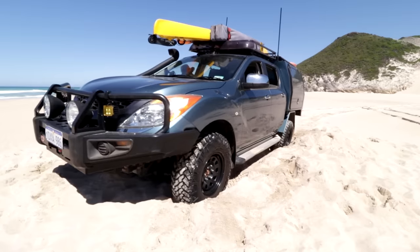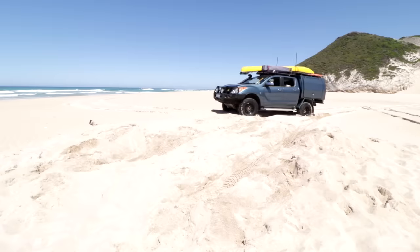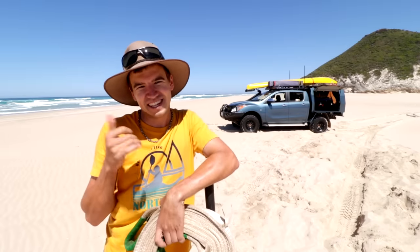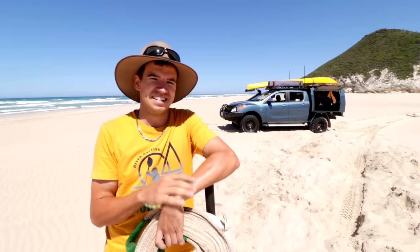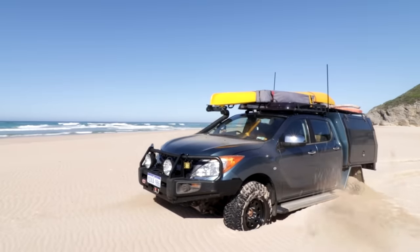I'm going to harden the ground a couple of times - this may seem silly but it means when I go for it I can give it the berries and just get out. Awesome, let's just get stuck all over again! I got myself out. What can we really learn from this video? For starters, basic four-wheel driving: let down your tires and your car's going to go so much further. What tire pressure depends on your car and tires - personally I run 12 psi on the beach. Second thing: driving technique - if you start getting bogged or losing momentum, just stop, don't plant it, because you're only going to go one way and that's not forward, it's down.